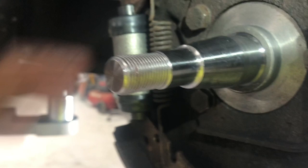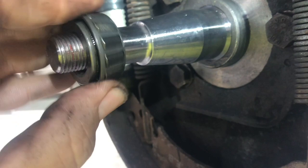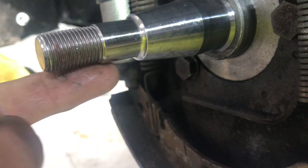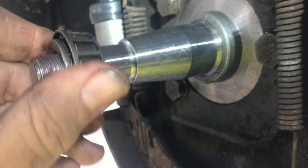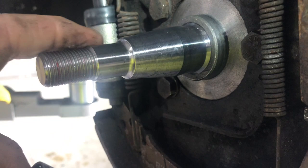My other concern is the possibility of the brake hose hitting the tire when turning. But the real big problem is the brake drum would not go on fully — the inner wheel bearing was hanging up, and the outer wheel bearing got stuck out partway instead of seating inside. This has not been machined properly; the tolerances are not correct. I've got two choices: take it off and try to get another one, or use polishing cloth to polish it so it can slide on.